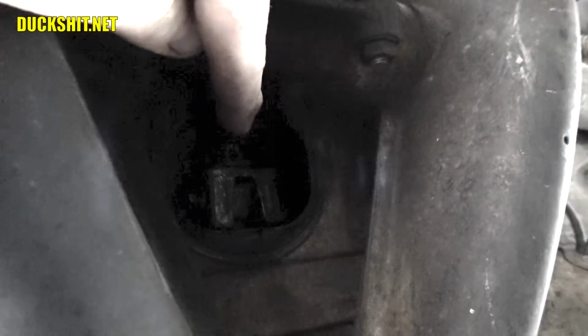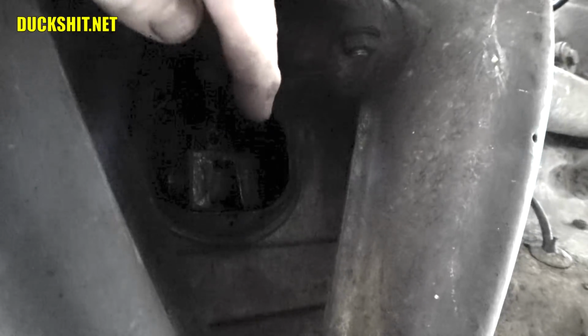All right, up under the car here is a shift coupler. I removed the grub screw from him, and he's already loose. I wanted to do that with you guys watching, but it was impossible for me to get the camera under here. Nonetheless, I clipped a little safety wire off of it and pulled the grub screw out. So that's now officially disconnected.